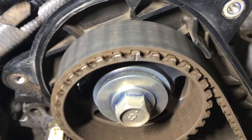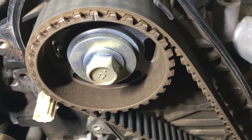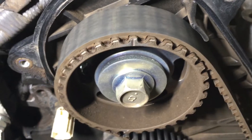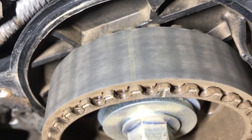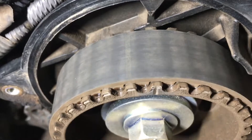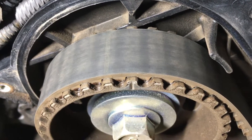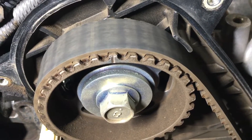If that's right, the rest of it's going to be right. On this old timing belt you can see that white mark there. With new genuine timing belts, we put them with the writing facing towards us. The side of the belt with the two marks closer to each other goes up here on the top side. Once the engine runs, the belt mark position is completely different, so forget about it - it only stays right when you set it up. As soon as you turn it over once, it's going to be out.